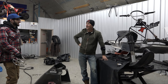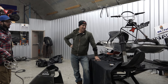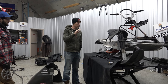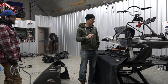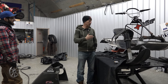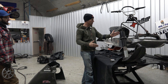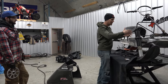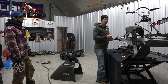I think it'd be pretty flicky, for sure. You thinking a wheelie? It's going to be way different because the track goes way up front. But when I'm done with it, you're still going to be standing on top of the track a lot more. I'm going to keep it up as much as I can — then it'll be a bit of a wheelie monster. But you still have to have that proper distance between your clutches, and you can't have your secondary clutch back where it's on your knee. So everything still has to be up front, and that's the problem I'll run into here — they have to be like on top of each other.